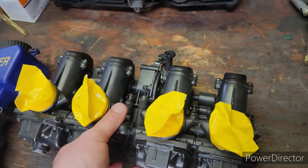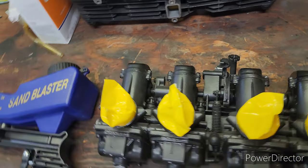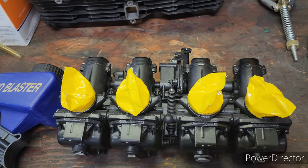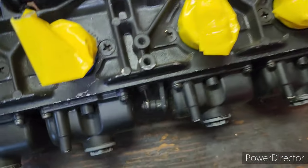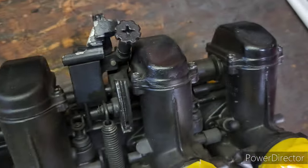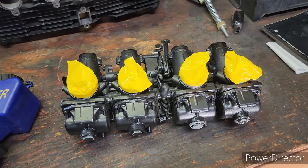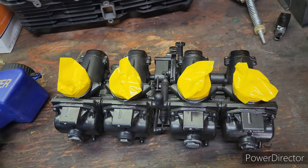With that project bike being all cleaned up and raw aluminum, I don't want to throw painted black carburetors in there. So I'm going to try this cheap soda blast gun that I got and see if I can blast these with baking soda without having to fully disassemble. I've taped everything up and covered all my ports and holes and fuel intake line. I'm gonna try putting this into my vapor blast cabinet just to keep the dust under control, and the used baking soda will go into the bucket underneath.